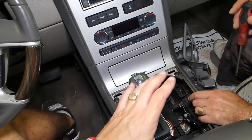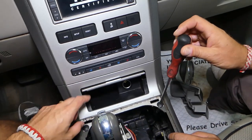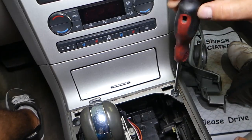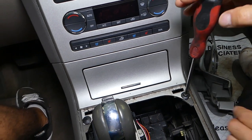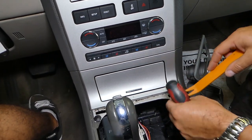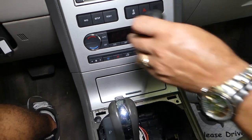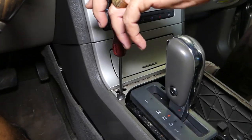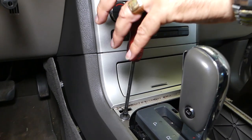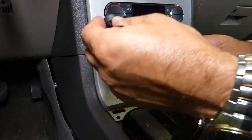Once we remove the cup holders, right here is your ashtray, and that compartment door often goes bad. We have two clips that we need to remove with a Phillips screwdriver. If you need the set that we use, it's an amazing set — we'll have the link in the description below. We'll share all the tools and parts information so it's convenient for you.